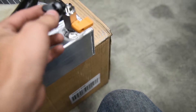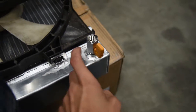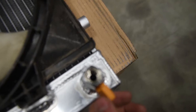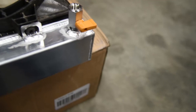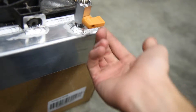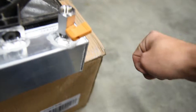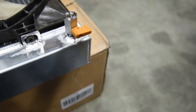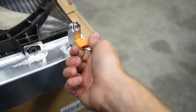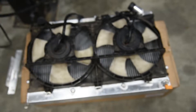The other thing I didn't like is that it comes with this plastic drain fitting for the bottom of the radiator. Good idea in theory, but it's plastic - it's gonna leak, and a lot of people have problems with them. So this is just a pipe thread style fitting. What I've got here is something we had sitting around - it'll thread into the radiator and it's got a ball valve on the inside. You really have to smack it for it to actually open, so I'm not worried about any debris from the road flipping it off. Just little tips and tricks for installing this kit.